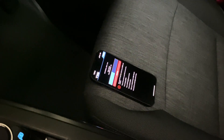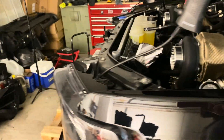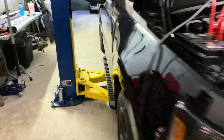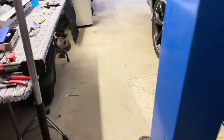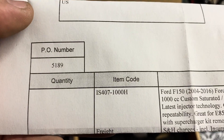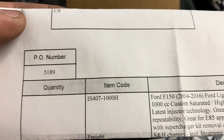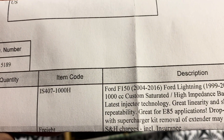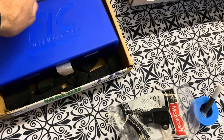While the tune is flashing, I ended up going with HP Tuners. I was going to use the Avid device — I still have it and might use it in the future. These are the FIC 1000s. This is the part number you want. Nobody really lists this part number, and it's confusing because it's listed as '04 to '16, but they work perfect on our setup.